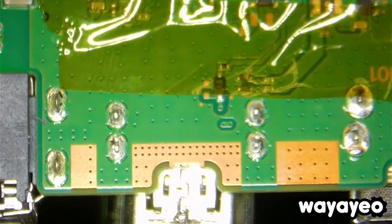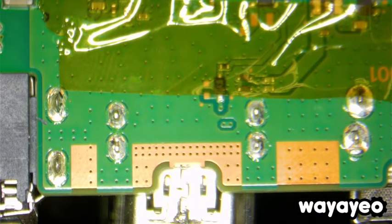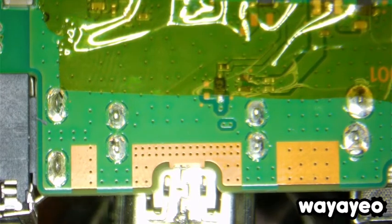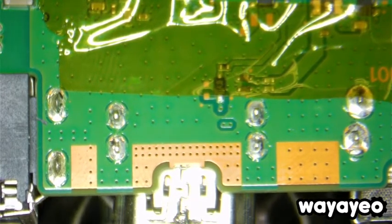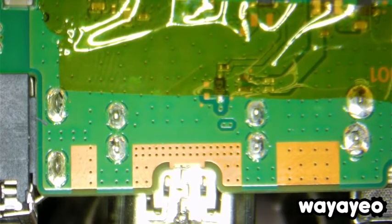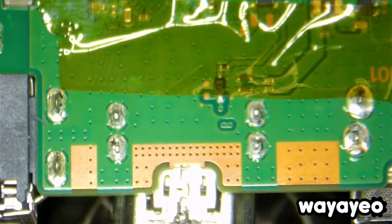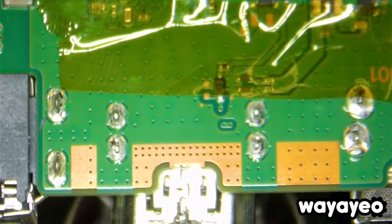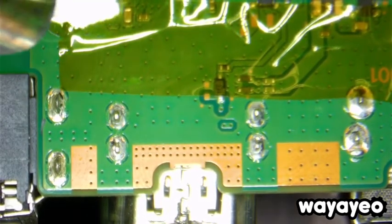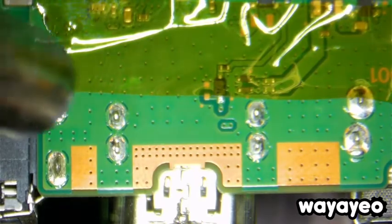We're going to focus on this point so that you guys can see, and we're going to fire our heat guns here. The temperature is the same as previous videos. I'm using a heat gun at the bottom of the PlayStation and as well as the top — temperature is 680 — so the process is pretty quick.